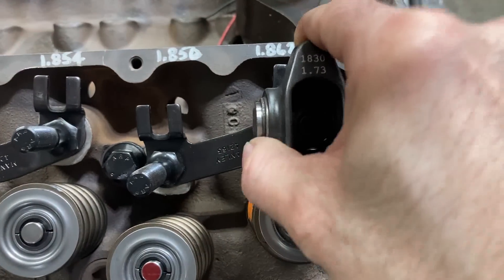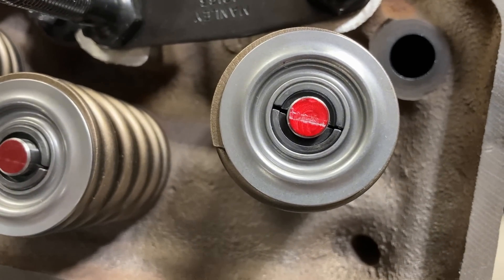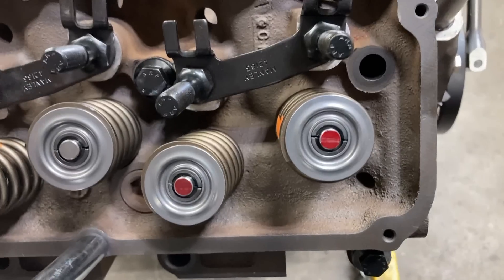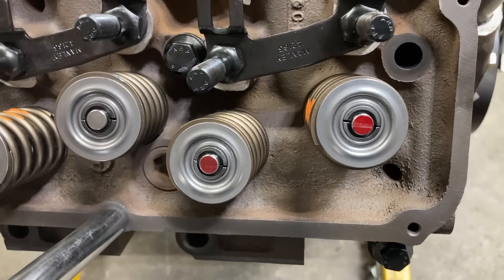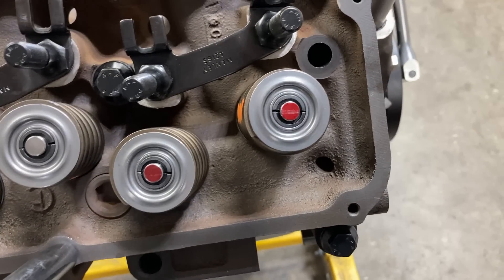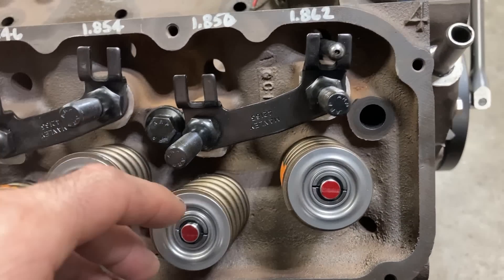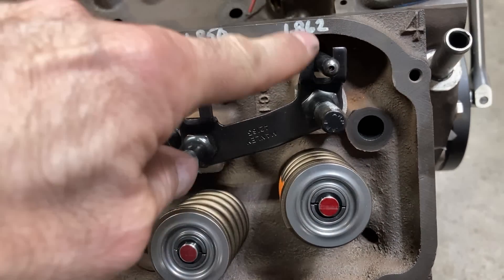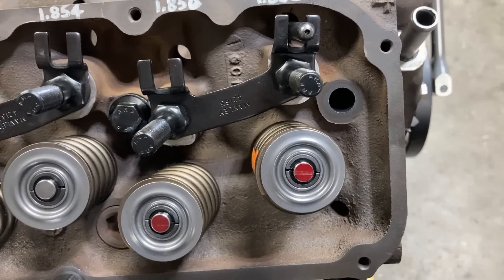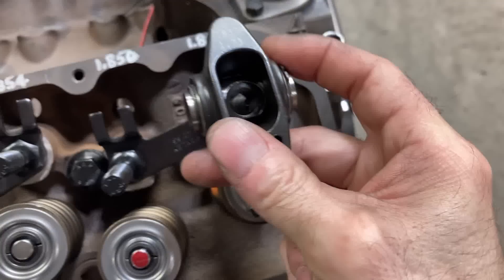Here's the pattern — it's still very narrow, still near the center of the valve stem, and I'm getting lift in the 620s at the valve. So we are in good shape. This is something you have to look at and make the determination based on all the data: what the pattern looks like, whether your pushrod touches your rocker arm, and how much lift you're getting at the valve.